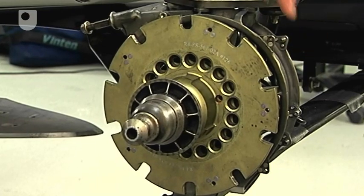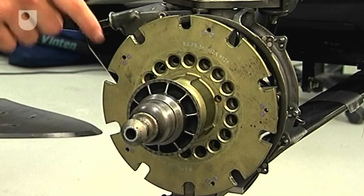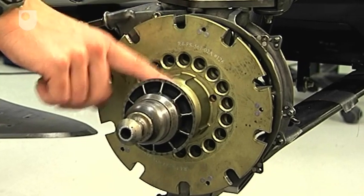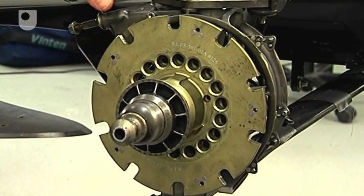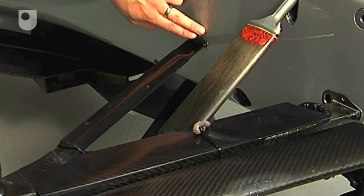And then this goes inboard which carries loads via bearings which are on the hub again, into the upright which carries the brake caliper and also all of the suspension components which here you can see carry all the forces into the chassis.